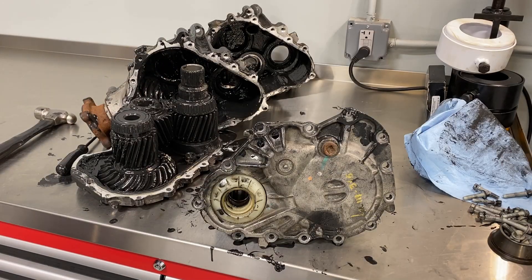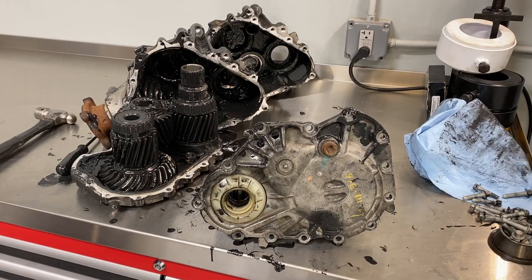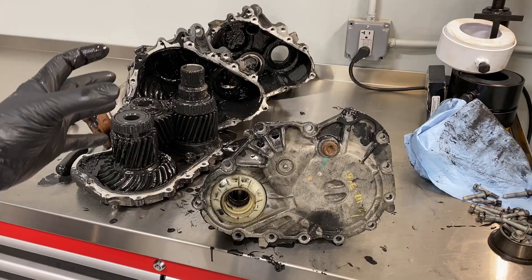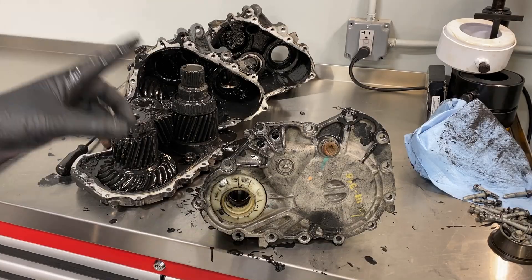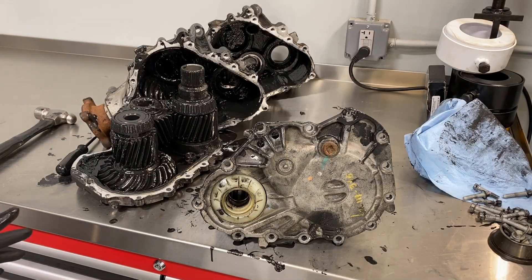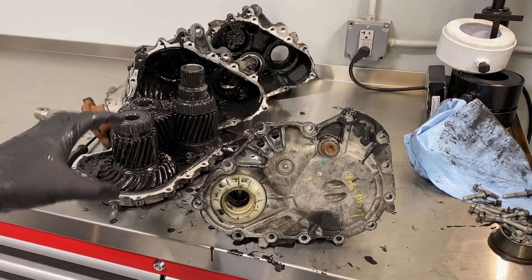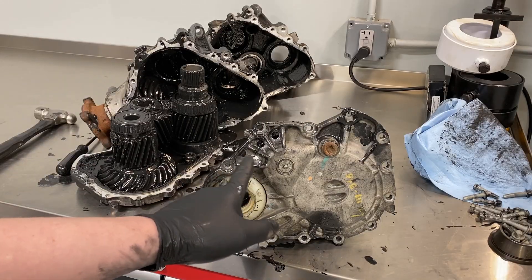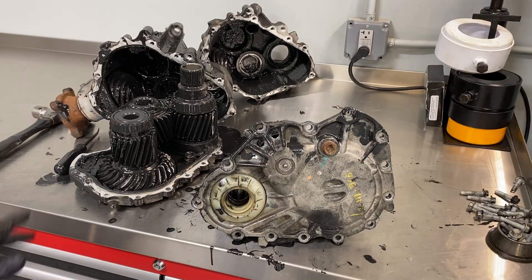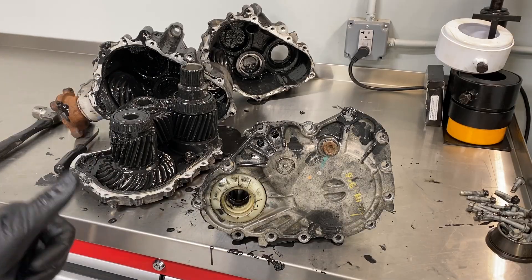You can see on this one everything failed and is contained inside, but sometimes these fail so badly that they explode and take out everything around them — brake lines, trans lines, coolant lines — they damage a lot of stuff when they explode. So maintain your fluid and avoid this. Drain plugs in this region are your option, otherwise maintain your fluid. Hopefully your PTU lasts much longer than these ones did — see you guys next time.